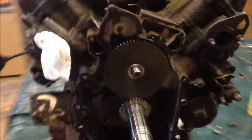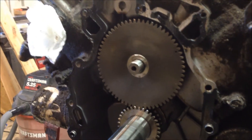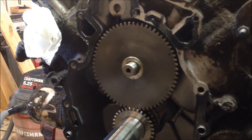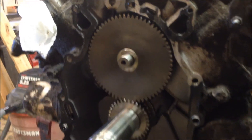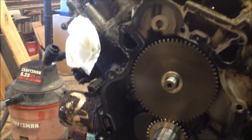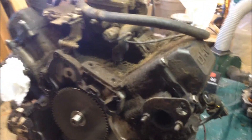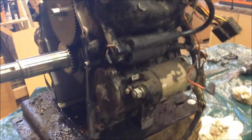When we took the inside apart, we found that somebody has already replaced it with a steel gear. I didn't have any notes on that — nobody said anything — so I figured it would have to be replaced eventually. Well, somebody replaced it but did not replace any of the gaskets, and that's why it started leaking oil all over.